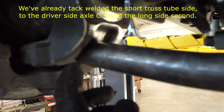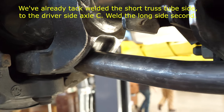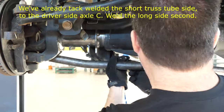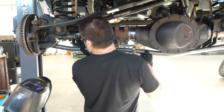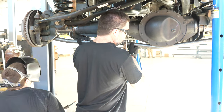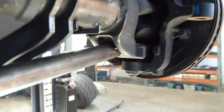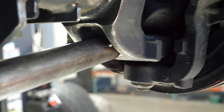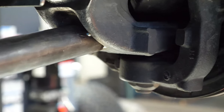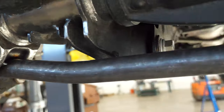This small gap on this side is what we want, but I'm just pushing straight up and we can close that gap. It doesn't take a lot of force — you could use a ratchet strap or tie down around the axle if you're by yourself. We've got two of us, so I'm going to push up on it while Casey tacks it. We're going for basically level — bottom of the tube level with the bottom of the C on both sides, making that angle look balanced side to side. Now we're tacked in place, about four tacks each side, nothing tacked in the center yet.